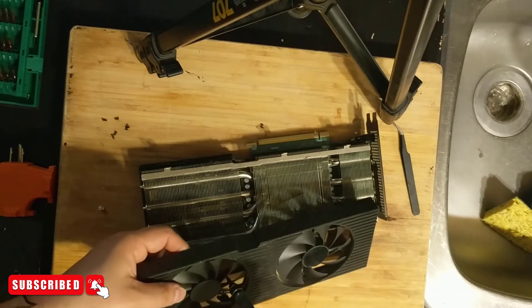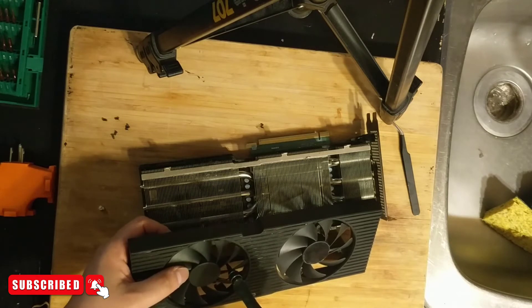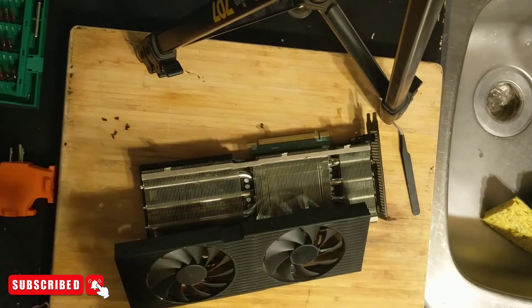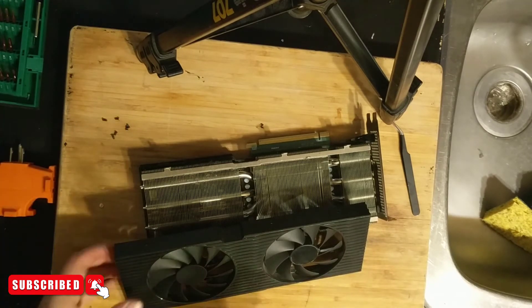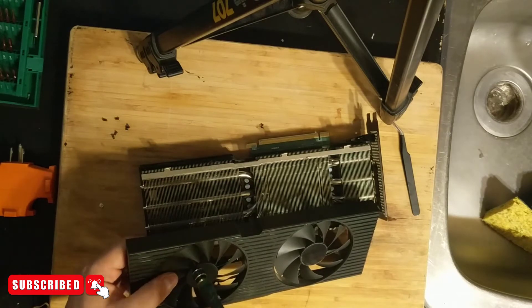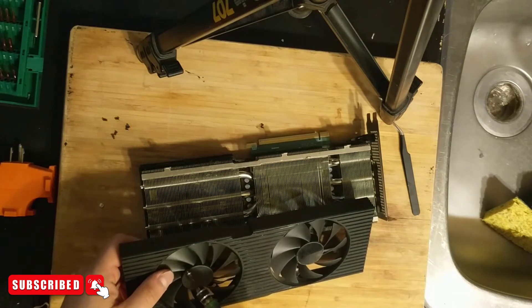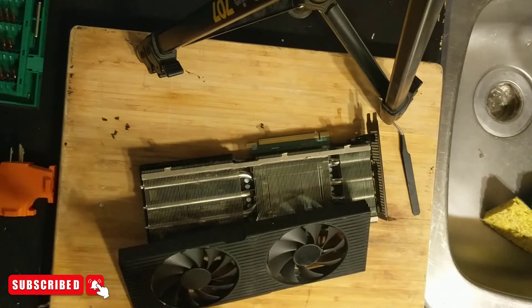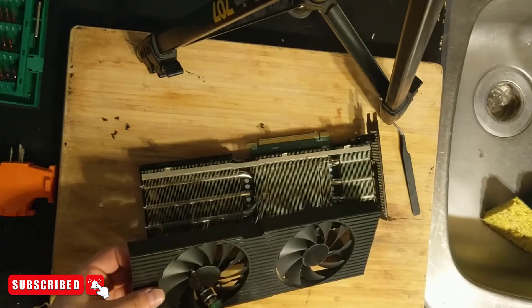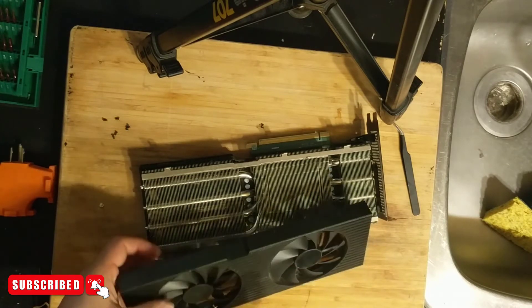Got one in! That's a score. Now you don't want to screw too hard because it's plastic versus metal — you will strip the hole and hate your life if you do, because then you have to use a bigger screw that might not be the right size. Just screw it in until you feel it just grab, and then slowly adjust the tension of the screw.